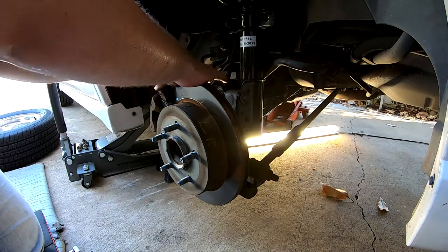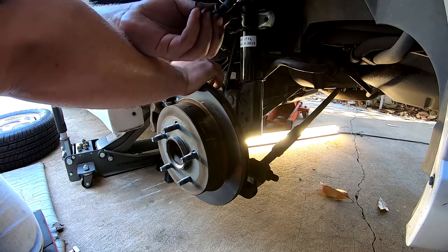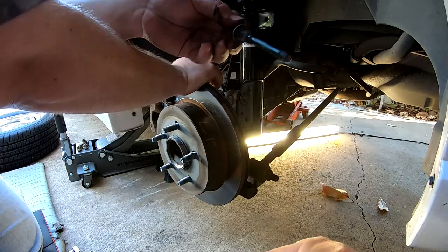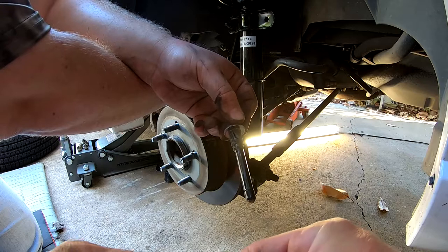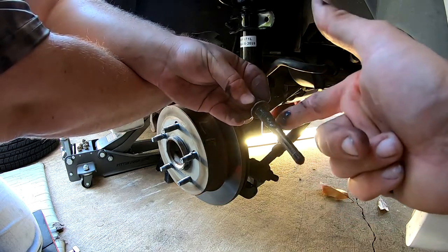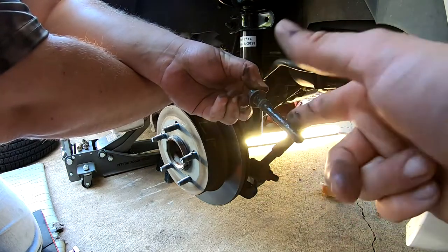No quality, but cheap. Just add some more grease since we're here. You see how it's kind of — there's not actually any tack to it. This is a brake and caliper grease. Sometimes 100% silicone is better or works just as good. So we don't need it on the threads, we just need it right here, because that whole caliper is sliding.